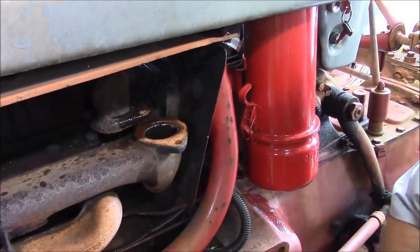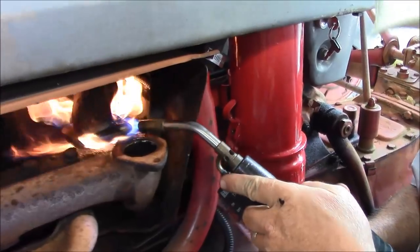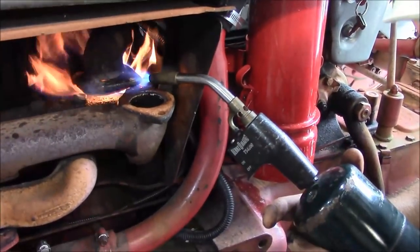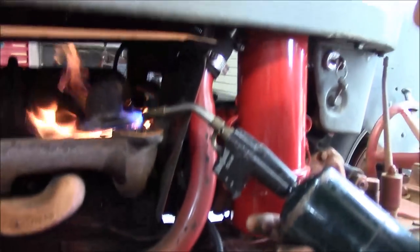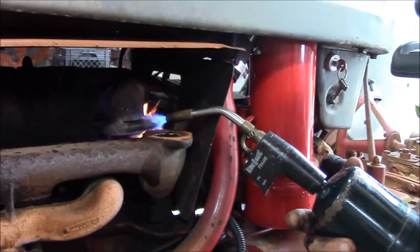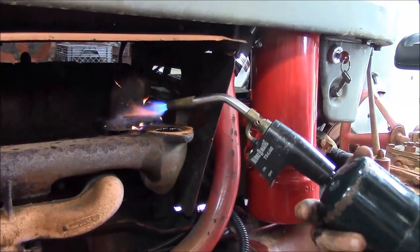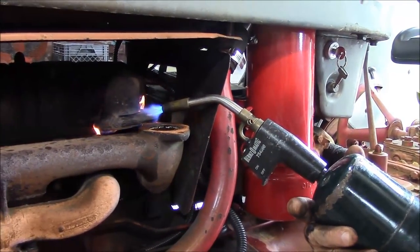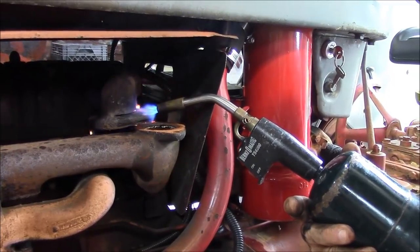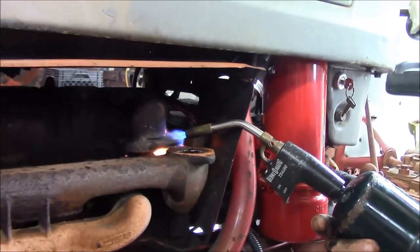These applications — this is severely seized and honestly there's not a lot you can do besides cut these off because they're just so badly seized so deeply. We'll go one more heat cycle with a little Knocker Loose on there. You can just see all the old Knocker Loose is just flashing off — it's got a pretty high flash point temperature and we're throwing quite a bit of heat to it.